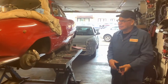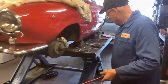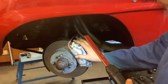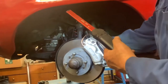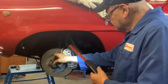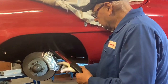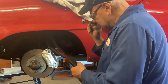Hello. It's Eddie at Alfa Man again, back with this lovely beautiful car. Come over here and I'll show you the progress I've made on the brakes. I've assembled the caliper up, bolted it on, put the brackets on, put the new flexi pipes on — on the rear as well as two on the front. New discs, the wheel bearings were really good, new pads, new kits in there. We primed and painted the caliper bodies — it's all assembled up beautifully now.